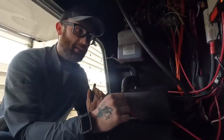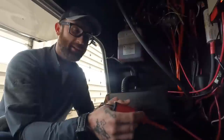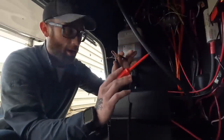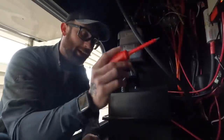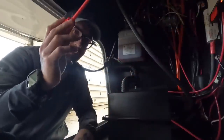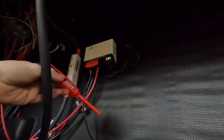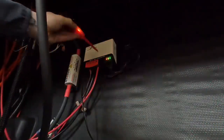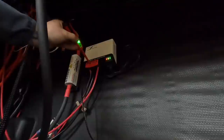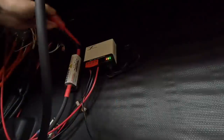You're going to learn so much about your electrical system, including the differences between AC and DC voltage, how they both work, and how they coexist in your coach. Back to our normal show — on a test light, all you have to do is ground it to anything that is grounded and then touch it to everything with one hand, versus a multimeter where you're juggling the meter, a ground probe, and a hot probe. This Power Probe test light is a little fancier — it will show me a good ground as well as a good hot 12-volt, and it also vibrates in my hand every time I get a good 12-volt source.